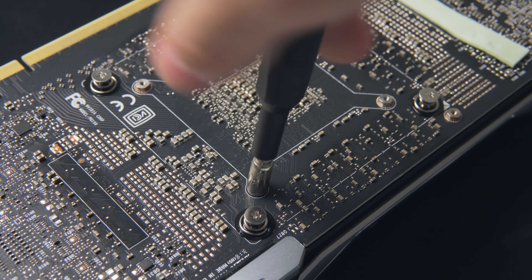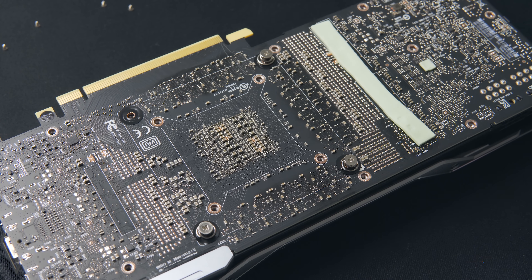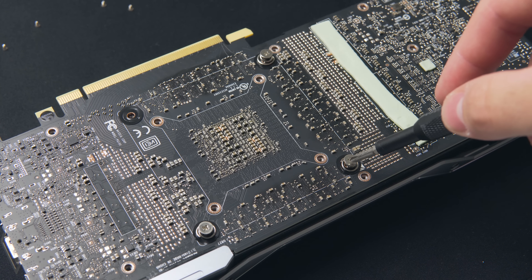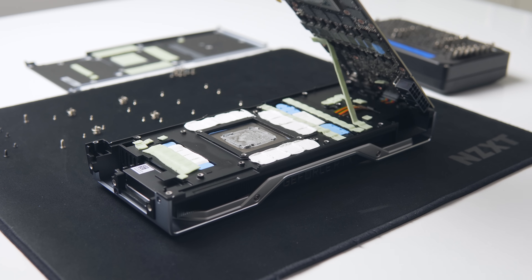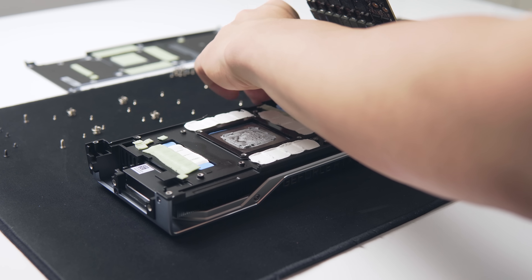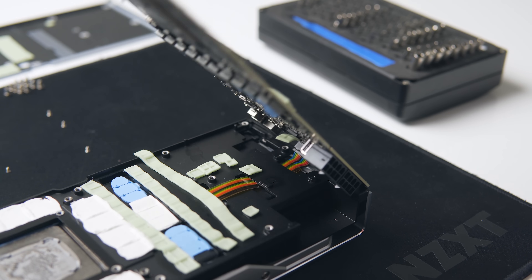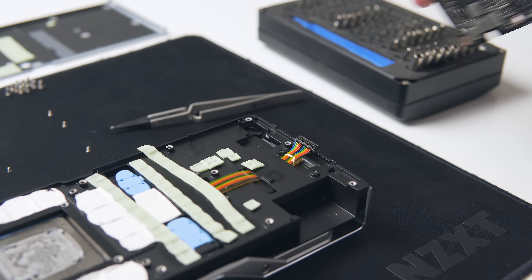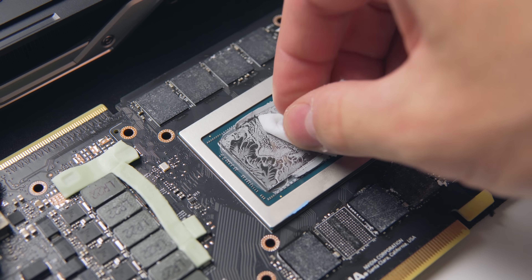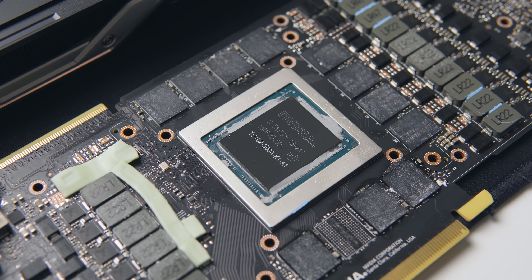For the final step you'll need a four-millimeter socket head to remove the last several screws holding the PCB to the cooler. The four main mounting screws should also be free enough to remove at this point. You should now be able to separate the PCB and the cooler — if it's not separating easily, double check that you haven't missed any screws. Lift the PCB up from the IO side and carefully remove the ribbon cable that attaches towards the end of the card; it doesn't seem to have any latches. Give the GPU and cooler a quick clean with some alcohol wipes and now we're ready to install the Kraken G12.